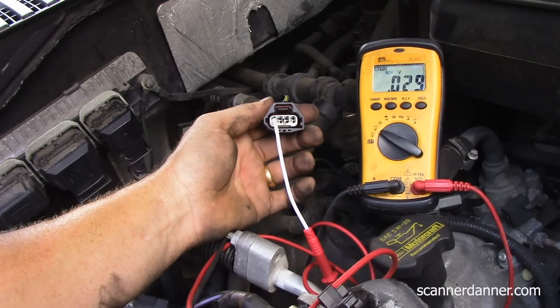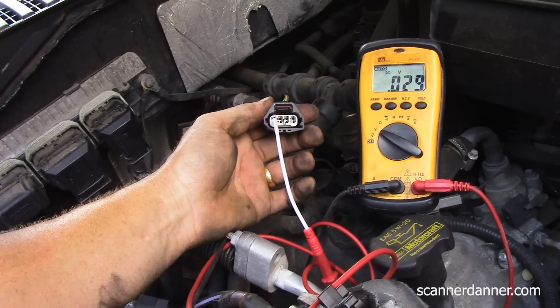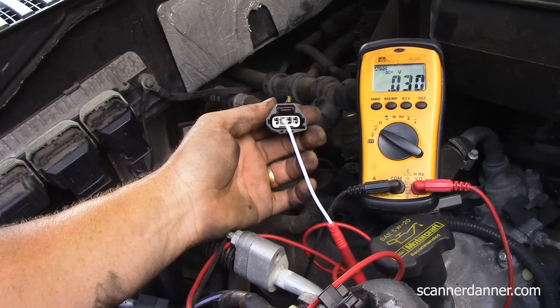Now I have a question — I'm not sure which one of these two remaining wires is the sensor ground and which one is the TPS1 signal. Maybe the 0.29 volt reading is the TPS ground, but I'm not totally sure. So where do I go from here? I want to identify TPS1, which has no bias, and do circuit testing — drive the voltage high, watch the computer change, drive it low, watch the computer change. Maybe I have a fixed zero volt signal on TPS1.